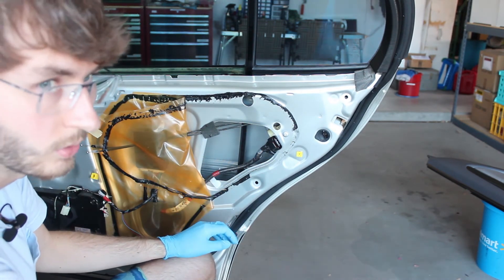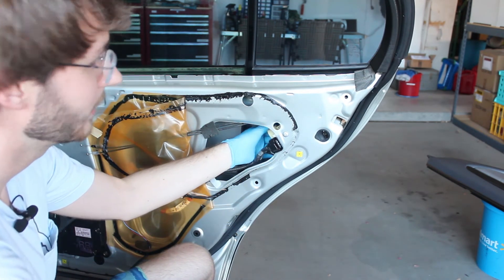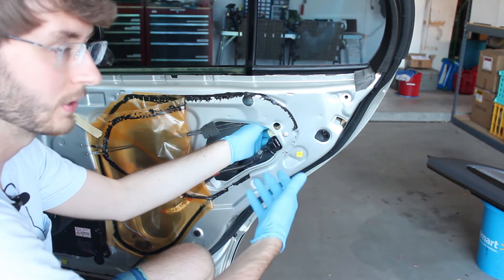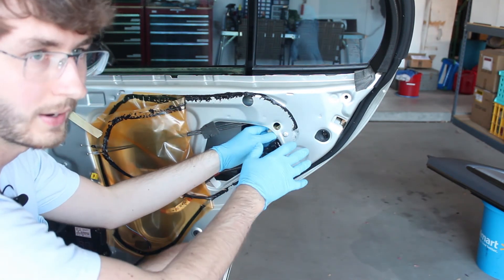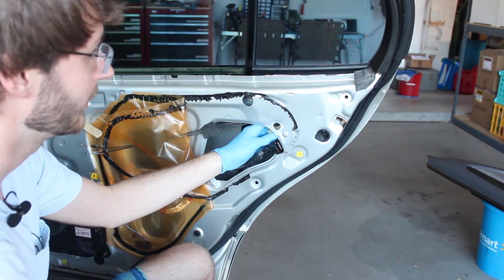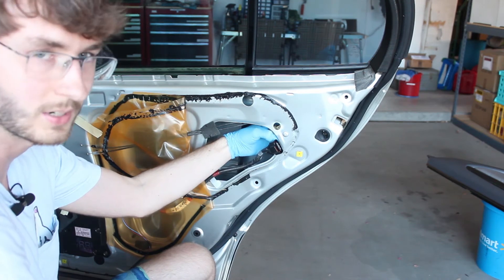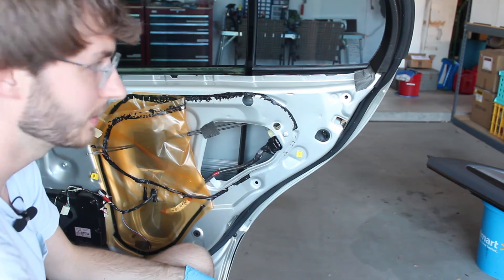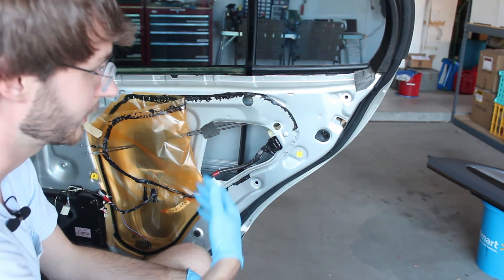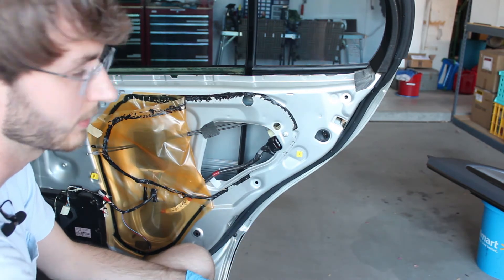To take it out, reach your hand up behind where it connects to the door handle — there's a flap that the door handle pushes down on whenever you lift it, and that's what actuates the door lock actuator. Push down on that flap and it should just slide right out. I'll show you what it looks like once it's out. The child safety lock switch is kind of the hindrance in getting this thing out, but you can get it out by wiggling it through the little maze of the door.